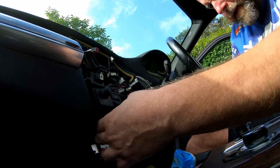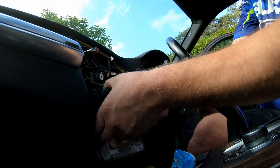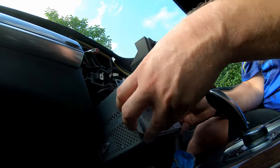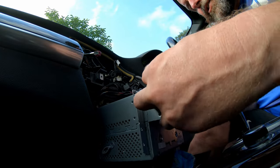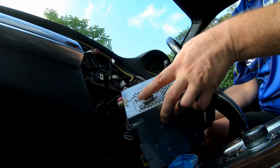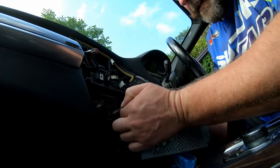I'll remove the CD. Lift it so that it clears the dash at the bottom — it's quite tight, not a lot of space, but it is doable. You have to be quite brutal with it, then slide it forward. The front face has just popped off but that will pop back on quite easily. Now we can access all the connectors at the back and disconnect them all.